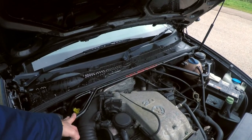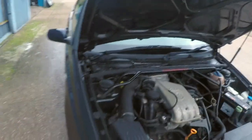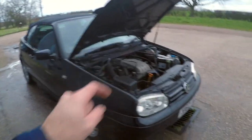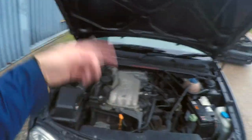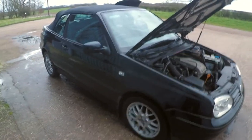What I'm gonna do is probably weld another bar to double it up and put a brace in the middle to strengthen it. That has actually made a difference in the convertible - you do feel the difference on the hard top, but on this convertible I think it definitely shudders less as you go over speed bumps, it doesn't shake as much. We're also going to build a rudimentary lower brace - one that goes in the front for the wishbone bolts and one on the rear - to tie the chassis legs and subframe together. See if the handling can be improved.